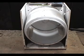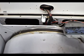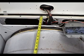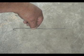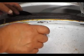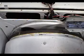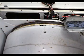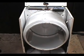Let me show you a little trick to hold the drum in place while you work. Align the screws on a baffle with this hole. Measure from this hole to this screw — it should be about 8 inches. Take a piece of coat hanger wire, make a hook on one end and bend the other end at 90 degrees. Unscrew this baffle screw about a quarter of an inch out. Connect the coat hanger wire between the screw and the back panel. The coat hanger wire will hold the drum in place so you could install the belt, the idle pulley, the front panel, etc.